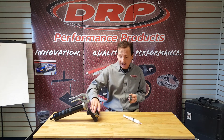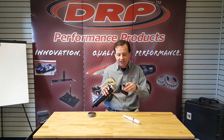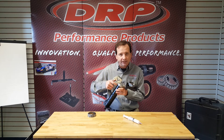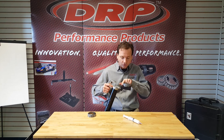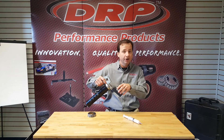When I have one available, I'll use one of our precision bearing packers. This works the same way as the syringe — it's just a lot faster because I can have it bench mounted and squeeze the gun with my hand. But once again I'm still going to do every other roller: fill one, skip one, then fill the next, going right around the bearing. No extra grease in the hub.